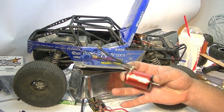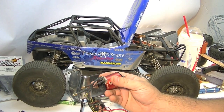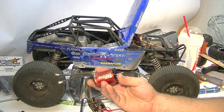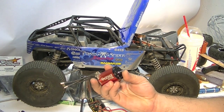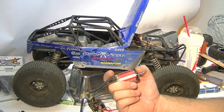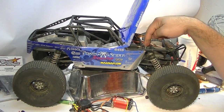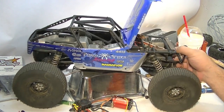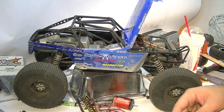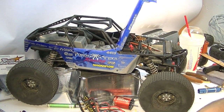As far as install goes, I'm not going to go over the whole install — it's pretty simple. The motor has a standard 1/8-inch diameter shaft so you can use your existing pinion gear. I do suggest going to 32 pitch when you do this, though you can use whatever you have. I'll be going to 32 pitch in the next couple of weeks, but I'll limp it through this weekend with the 48 pitch stuff. I'll be installing the Mamba Max Pro in the location between the front shock mounts where the other ESC already is, and just swapping out the BEC for the one already wired up to make the install easier.